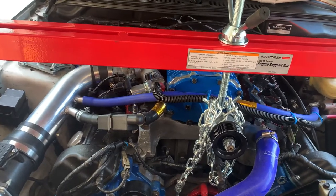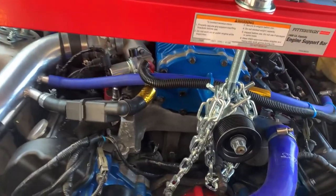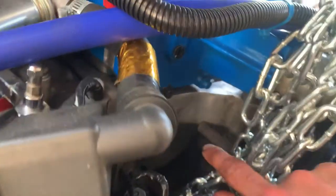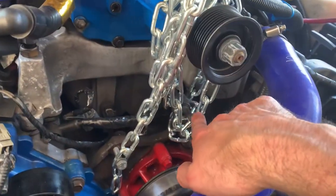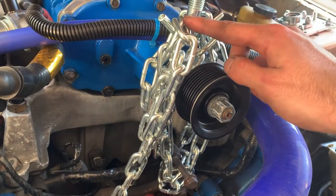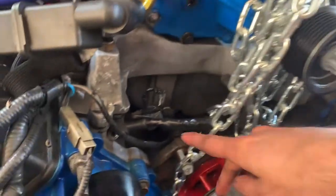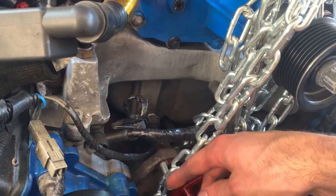First, to support the engine, I did it a couple different ways. The first one is I got this Harbor Freight engine brace and basically just used the bolt that was holding the pulley here. Behind it I put a sleeve over it just to protect the threads, then ran one chain, hugged it underneath, and clipped it on top. The second chain that comes with the kit crossed it, hugged it underneath, and hooked it up on the second part. This wasn't holding any weight but was just there for additional safety, and the slack was perfect.